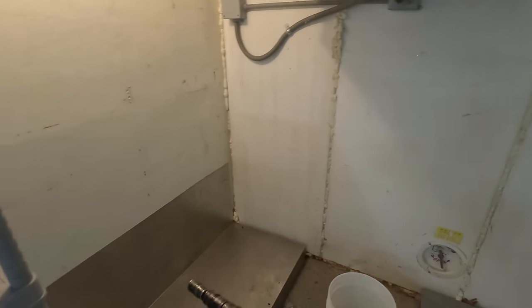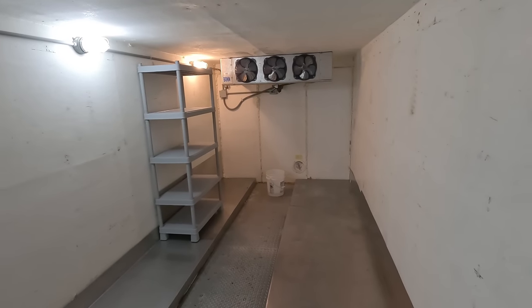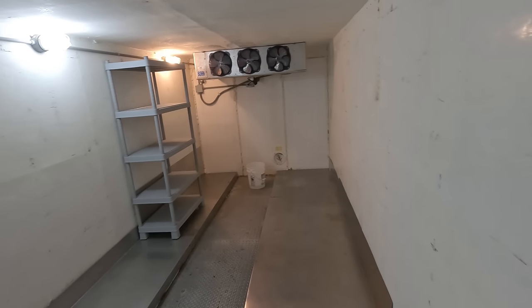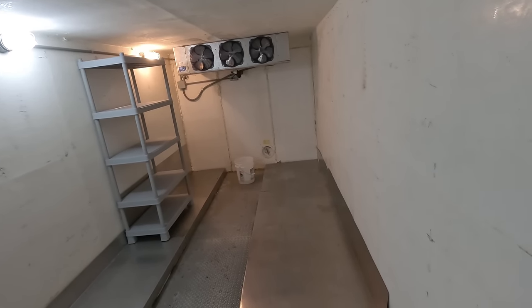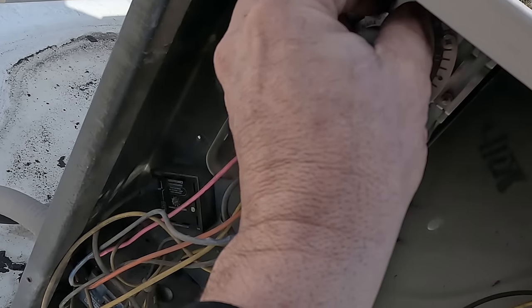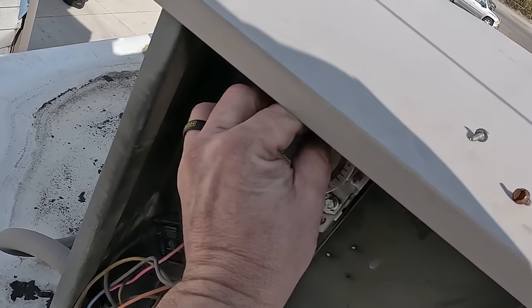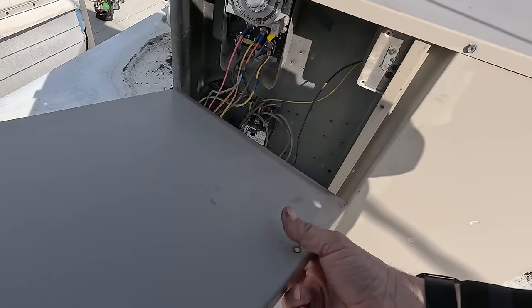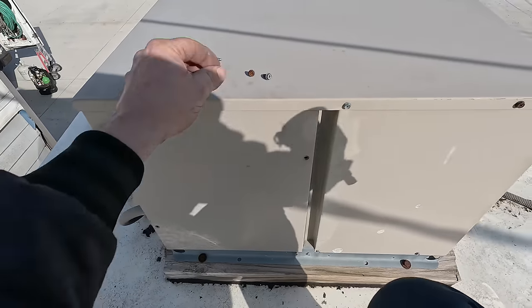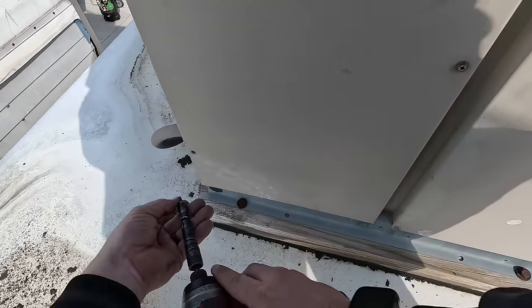We're going to raise that up a little bit. I mainly just raised it a little bit higher. I don't think it's going to make a huge difference because aluminum transfers heat pretty quick. We'll see how that does on the next go around. All we can do is try to make his problem better. I told him we may have to lower that drain line. Let's take the defrost timer back down to about 25 minutes like I had originally. That way, if it ever fails or whatever, it won't be such an issue.